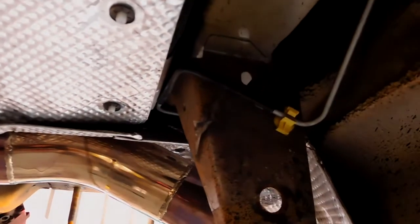Another thing I need to cut out - there's a bit of sheet metal in the actual body of the car that needs to get chopped off because it gets in the way. It's going to hurt actually chopping a part out of my car, but hey, it's got to be done. What I was doing here was cutting the diff bush support off of the K-frame - the OEM support all needs to be removed. Cut the bulk of it off - half of it had snapped off anyway - and then grind all the welds and excess sheet metal off afterwards to make it a nice clean surface, ready to weld.